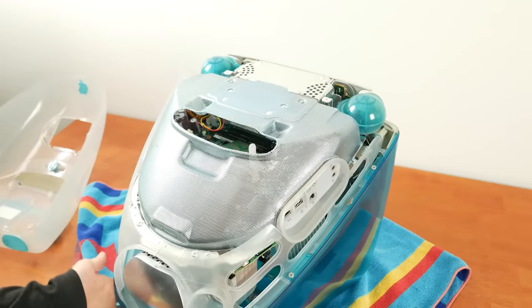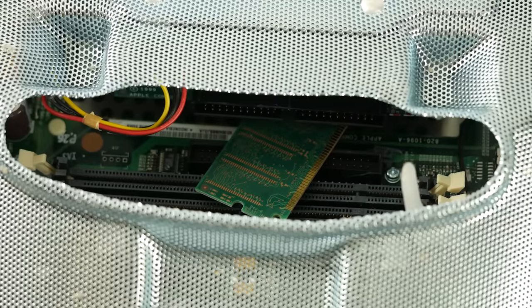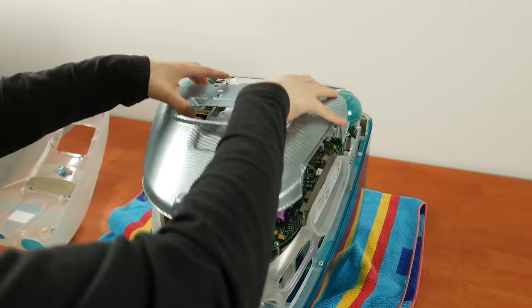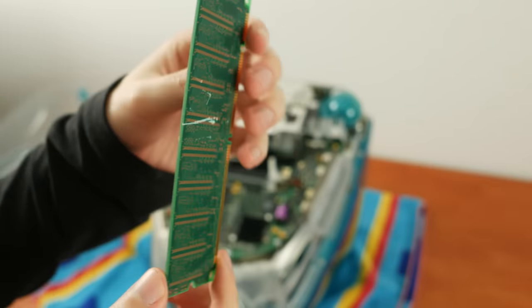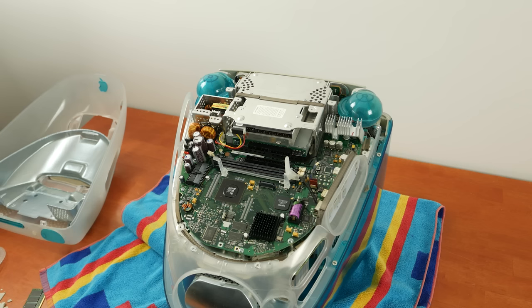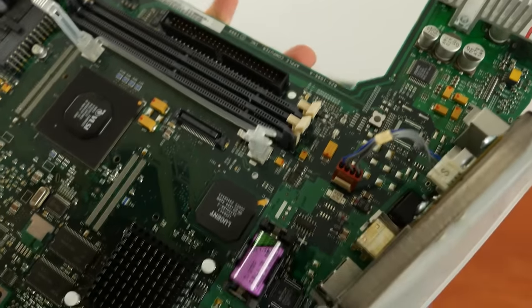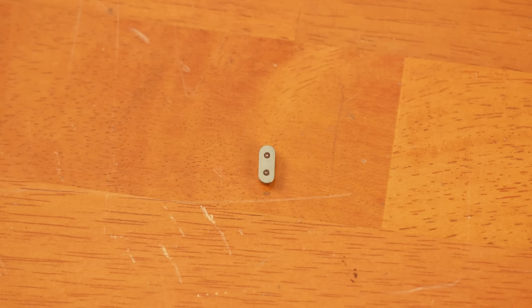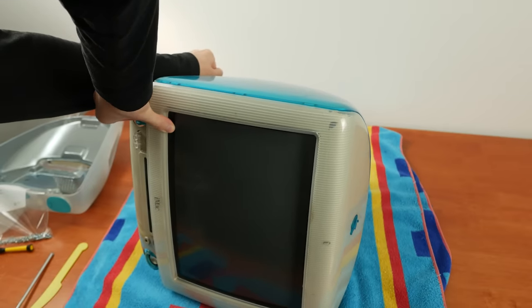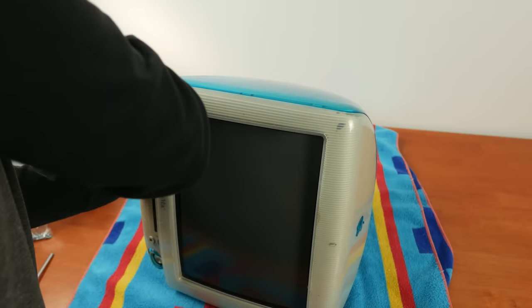It got even worse when I looked at the board. The RAM had somehow gotten ripped out of its socket and shoved underneath the hard drive - it was even slightly bent. The socket clearly took some damage as well. I have a pretty strong feeling this thing was dropped at some point, which would explain the cracked plastic on the front. I found even more damage after taking out the logic board: the RAM stick had managed to knock two surface mount components clean off - a capacitor and a crystal oscillator. The latter I somehow managed to recover from the pieces that fell out. I decided to continue disassembling, and I had an idea for this inner bezel I wanted to investigate further.